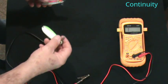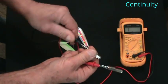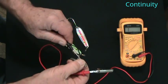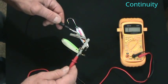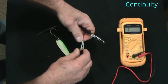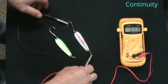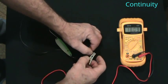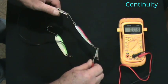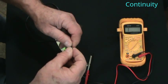First thing we'll look at is continuity of your lures. I have my test meter set on 20 ohms. Most test meters come with just the probes, but for a couple of bucks you can buy a six-pack of alligator clips — scrunch them down with your pliers and friction fit, works well. Continuity basically means electricity can flow through, a dead short. I make my lures so that I go from end to end with continuity. More importantly, you want continuity from the anode into the lower body — I have a contact there, so that's great. They do corrode so you have to give them a little scrub once in a while, though once they're in the water they'll likely clean themselves and maintain contact.